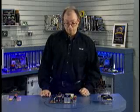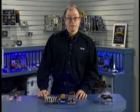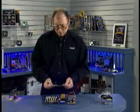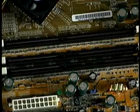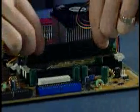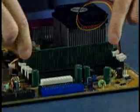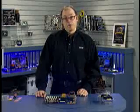Now we need to install the memory before the motherboard is ready to go into the case. This motherboard, like many today, uses double data rate SDRAM, which comes in what we call a DDR DIMM. A DDR DIMM has a single notch that is offset — not directly in the center — as part of the keying to prevent backwards installation. I have three DIMM sockets on this board; I want to install in the first one, closest to the processor. Bend the plastic tabs to either side, insert the module with the correct orientation, push down until the side tabs engage, and the DIMM is successfully installed.